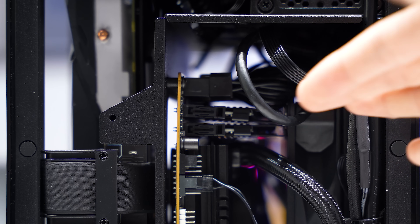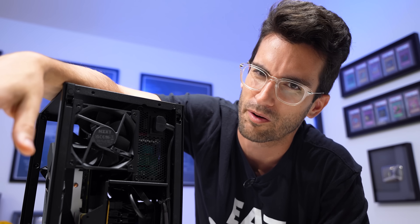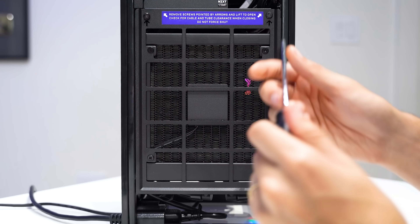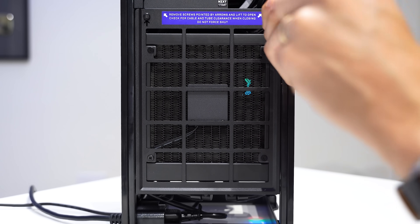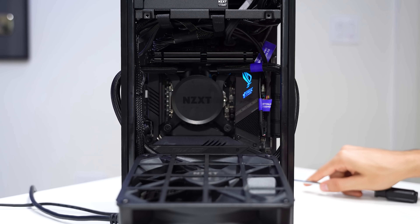I feel it's also important to note that prior to picking this up, I had the owner attempt to power the system on with all peripherals disconnected — so things like his keyboard and mouse — in an effort to circumvent that overcurrent notification. It didn't work though. We can access most of the internals by removing these two captive Phillips screws that hold the radiator portion of this AIO in place. And it should just hinge down like so. Kind of a clever design.